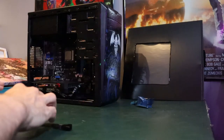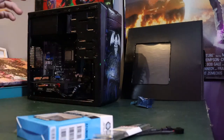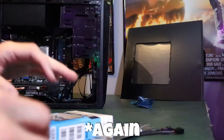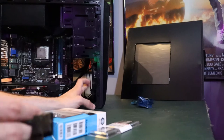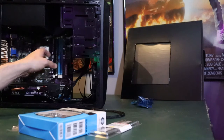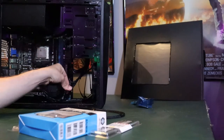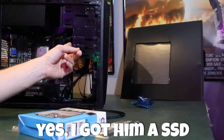Guys, so we're back again. We finally got a shipment of our stuff, and I actually jumped the gun and threw some of it in here before we started the camera. Already installed, we got our Molex 2 fan connector to get our front panel fan connected, because there is only one chassis fan header on the motherboard here. So we'll just run that one off of Molex. And then we got our SSD installed and ready to go, along with our hard drive.